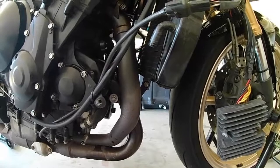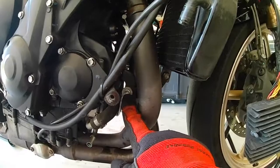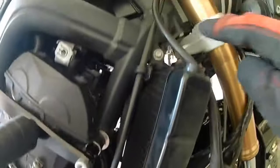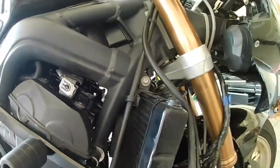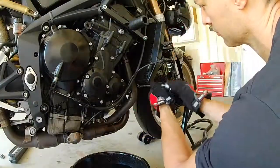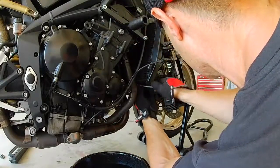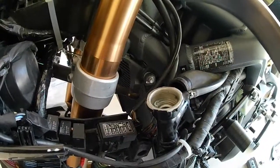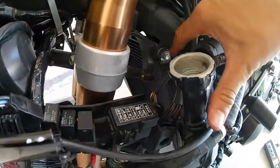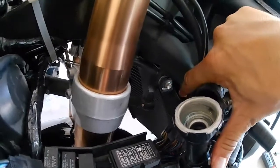So we're going to drain the water. What we're looking at is the right side of the radiator, and we're going to have to remove some brackets — one behind the header, one down here, one right here, and one on the opposite side. Those are 8mm. On the left side of the radiator where the fill cap is, the last screw to remove is right here, and again that's an 8mm.